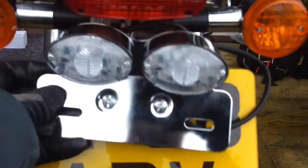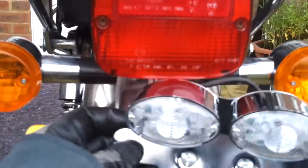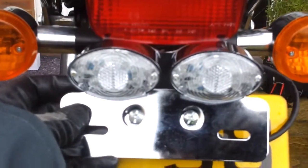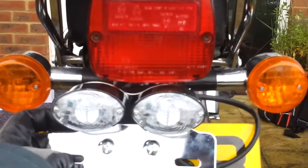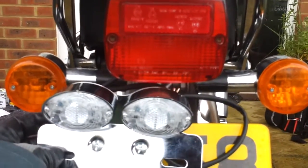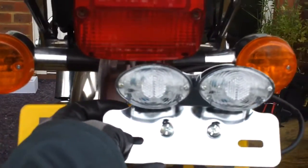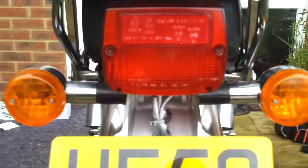All it's doing is restricting the light coming off of there for the number plate, so that's why I was going to sit them either side. Plus the indicators are further apart. If you're coming up behind someone and there's just a load of flashing stuff going on here, it's a little bit confusing for other road users, so I'm going to separate them somehow or other and put them one there and one there. Okay, wish me luck. See you later.